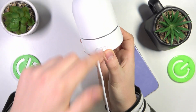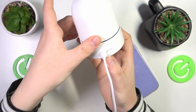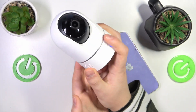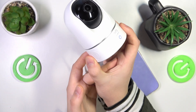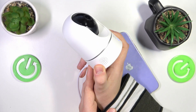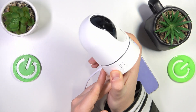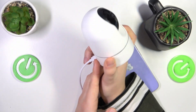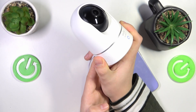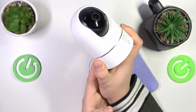Press and hold this setup button for about 10 seconds. Once you hear two distinct beeps, that means the factory reset and initialization went successfully and your camera is being hard reset. Just press and hold this button and wait until you hear two beeps.